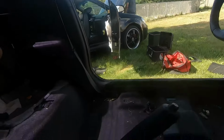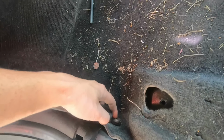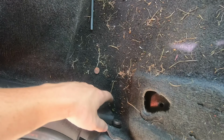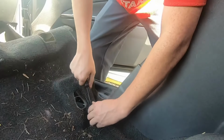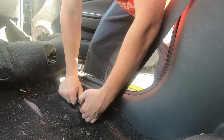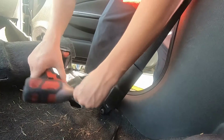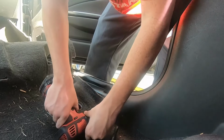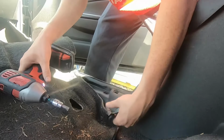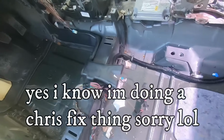He's doing that car as I'm going through this car, but I don't want to get ahead of myself, but we're doing the Torx bolts on the seat belts to take the rest of the carpet out. Grab a T50 with a ratchet wrench, break them loose. They have red Loctite. It's gonna be really hard with just a drill to get them out. Once you break it loose, grab your drill. Comes out the rest of the way. Carpet is now out.